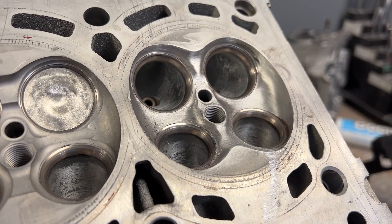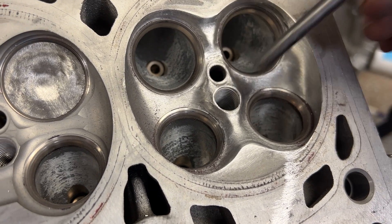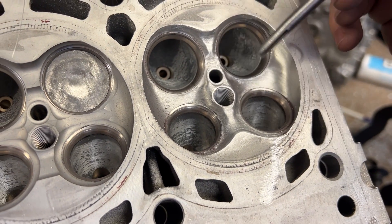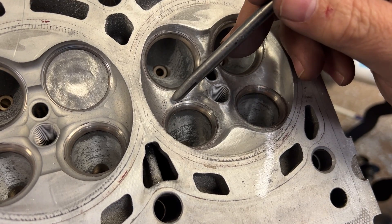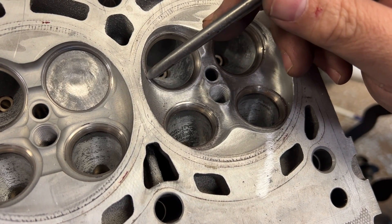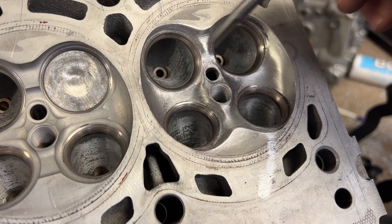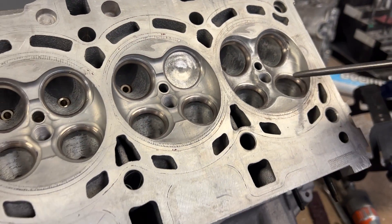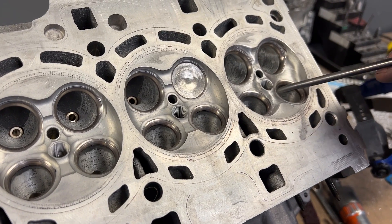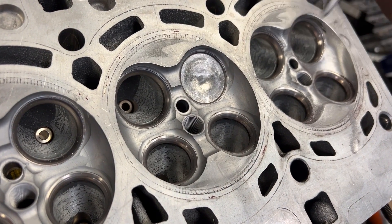It's dirty, it's all done. You see I made this flat again, and it's not alarming that I hit the spark plug hole — everything's blended right into the top cut of the valve job and we softened this thing all up. If you compare it to stock over here, you can see how much I didn't take out, but also I did — I just reshaped stuff. This way when it gets milled it'll go right back to stock.